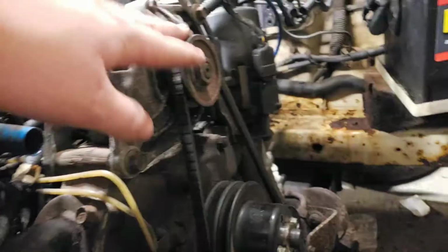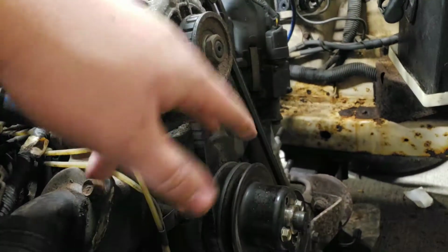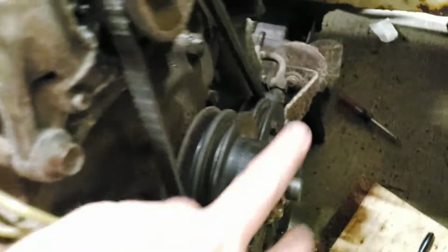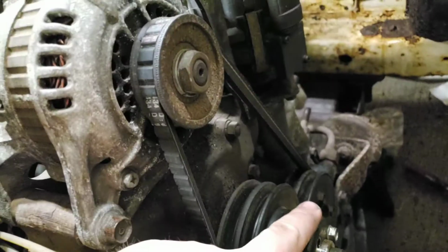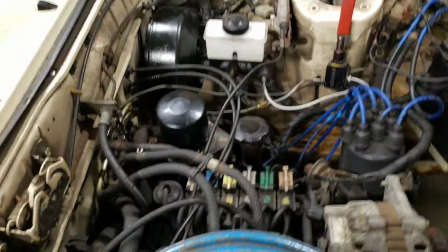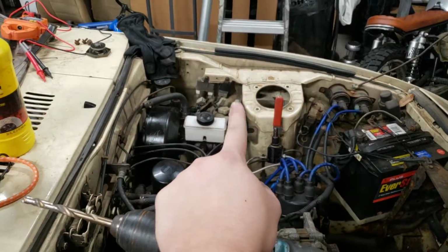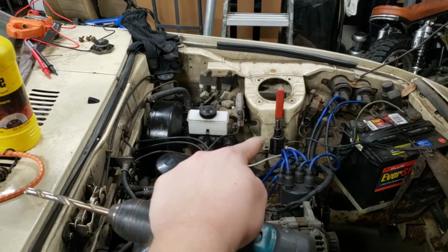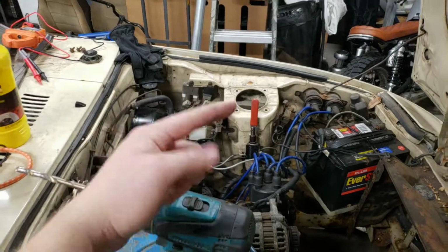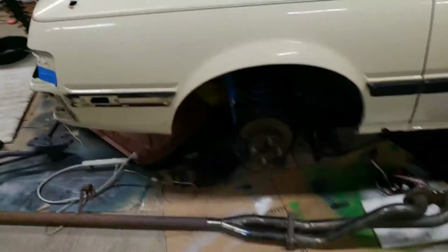So what I'm going to do is grab a double belt pulley. They're pretty common. Two stock alternator belts, brand new. And run them between, this is the water pump, down there's the main pulley and the alternator pulley, and we'll get those done. Rat's nest, probably going to delete for now, it's okay. There's a newish brake booster, just one that we know works, and a brake proportioning valve from Wilwood for the back, because sometimes when you put stainless lines in and a rear end swap, it locks up. We did swap the rear end.